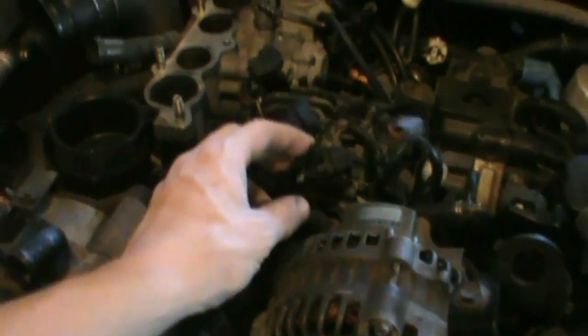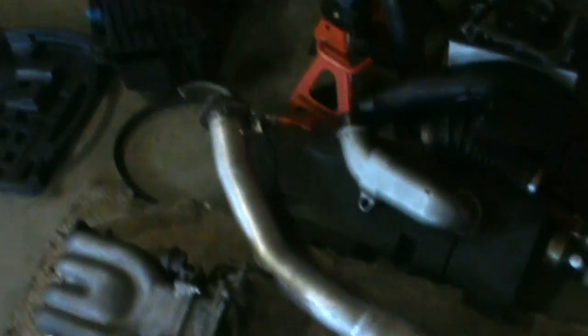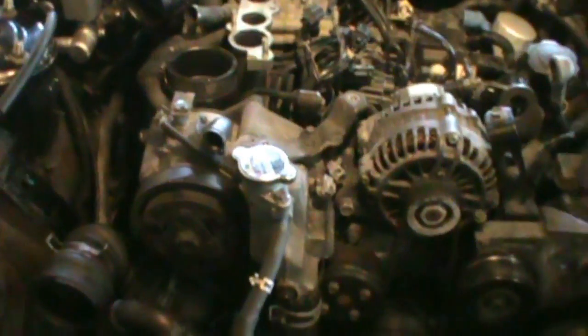Anyways, I'm gonna get back working on this, I'll pick up where I left off yesterday. You can see I started disconnecting some wires — I got the alternator disconnected and everything. Just gotta take off the coil pack rack thing so I can get to the rats nest underneath. So you can see the parts I've already taken off: the intake manifold, the downpipe, all the intake pipe, the battery tray, power steering pulley, and airbox. Doesn't look like a lot of parts, but under the hood it clears out a lot of space.